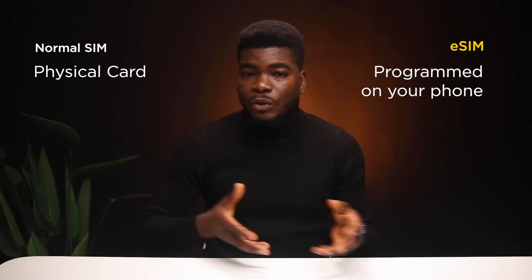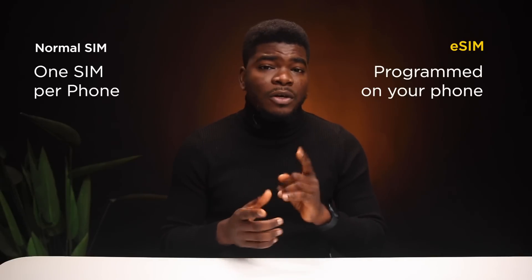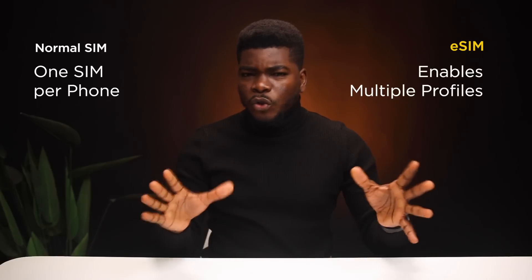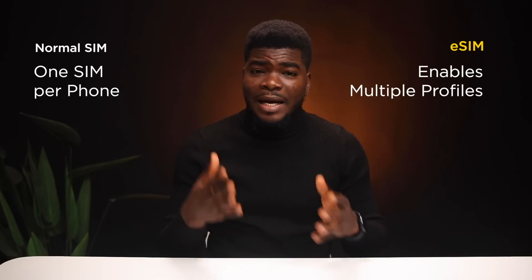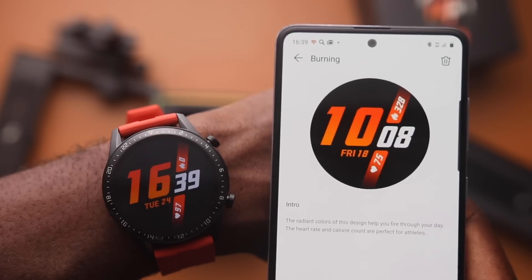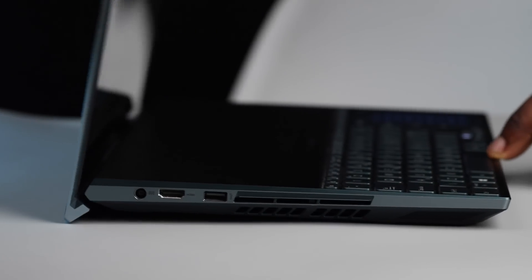The main differences between an eSIM and a normal SIM card are: you don't have to worry about a physical SIM card — it's only a reprogrammable logical profile on your smartphone. A regular SIM card holds one profile for the customer, but an eSIM enables multiple profiles, which is a better advantage. Also, technology is evolving rapidly, and with an eSIM you now have your SIM profile on things like smartwatches, cars, and your computer. With the same eSIM profile, you can enable it to work on multiple devices, unlike a regular SIM card tied to just one smartphone.